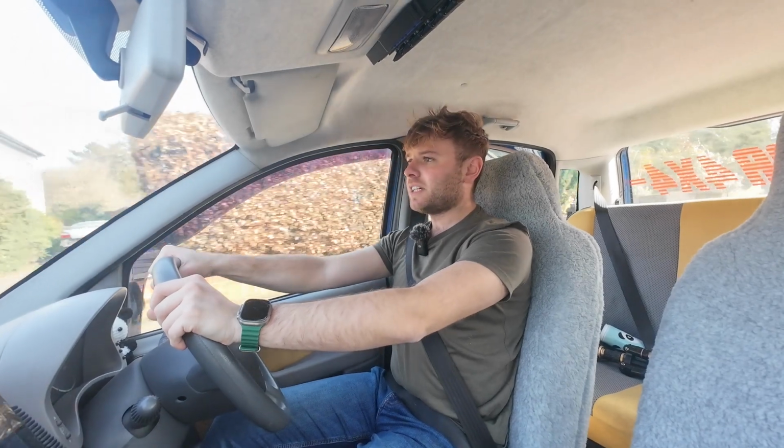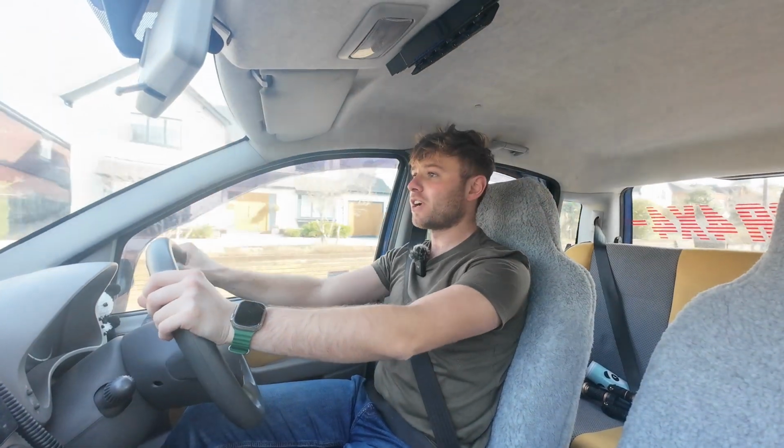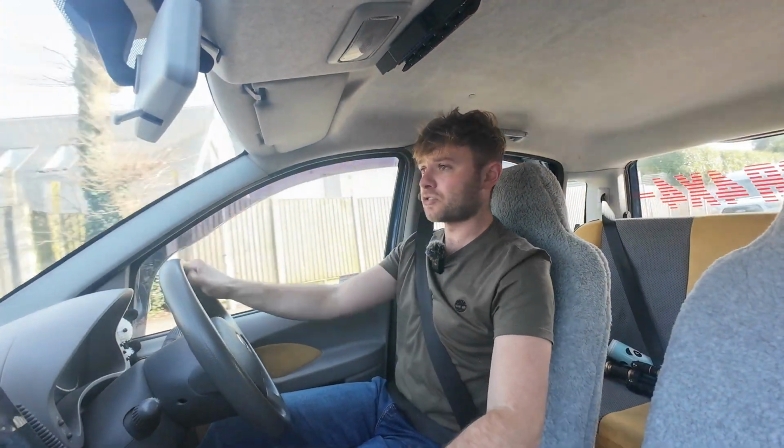So we're now out on the road, and the question is, what is it like to drive with the 141 World self-locking rear differential? And to be honest, there's no difference at all. There's no sound coming from the rear. Even when I'm going around a corner, that ratcheting noise that I thought would be louder, I can't hear at all from the inside. You can barely hear it from the outside. I'm guessing it'll be the same if I was running a viscous coupling instead of my mechanical coupler. That shouldn't change anything, because in normal driving, the viscous coupling would be disconnected and it would only connect up when it senses wheel slip. But yeah, on normal driving on the road, there is no difference at all, no extra noise.